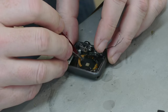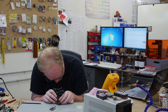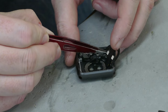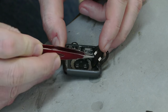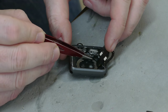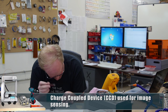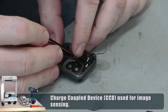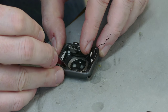Let's peel up the vitality sensor. These are probably some sort of LEDs that emit some frequency of light that reacts to your skin. The two sensors here probably get a reaction to the light from your skin — through that they're able to determine your heart rate. Underneath this you can see the inductive charging coil — see how it goes around the bottom there?